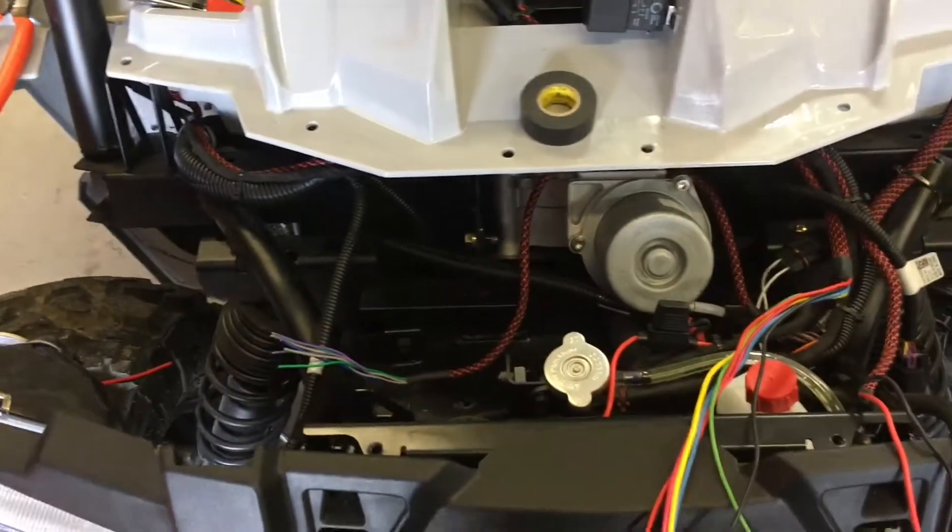I'm not 100% sure how I'm wiring the CVT fan yet, but we'll figure that out. I also need to figure out my temp and oil pressure gauge wiring. I've got to tap into the oil pressure sender - it's pretty easy to locate down here. This is the clutch inlet right here - I believe it's a two-inch inlet. My plan is to get a two-to-three-inch elbow and another elbow to route down and put the blower in this area.